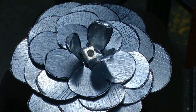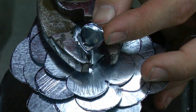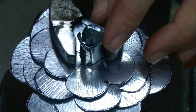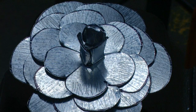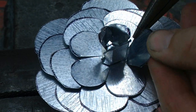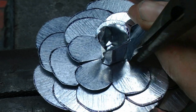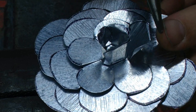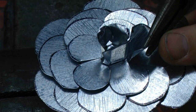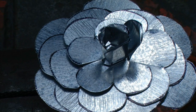I am then going to come back with large slip joint pliers and gently bend each of those petals towards the center. We want the flower to be folded up very tightly, but we don't want to be too aggressive where we break the petals. We are going to follow the same procedures with each additional petal — the sides being rolled inward ever so slightly, the top being rolled back. Every two or three petals we can use those slip joint pliers and push them in towards the center.